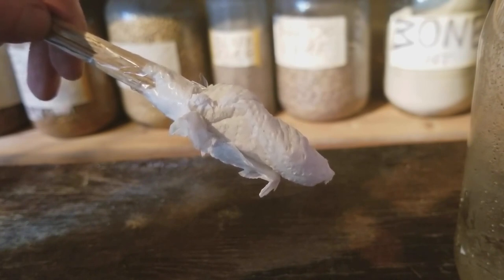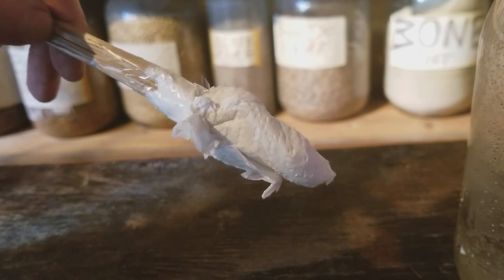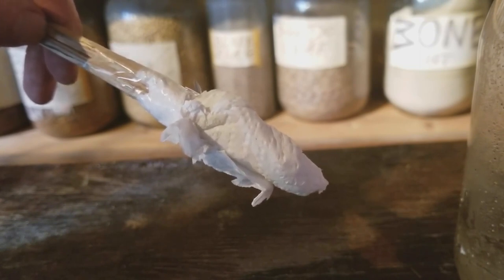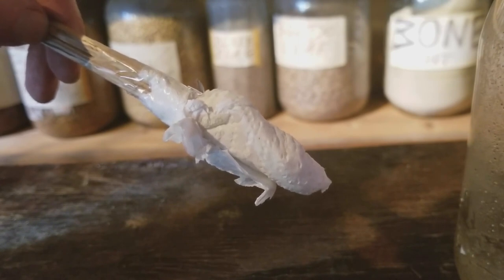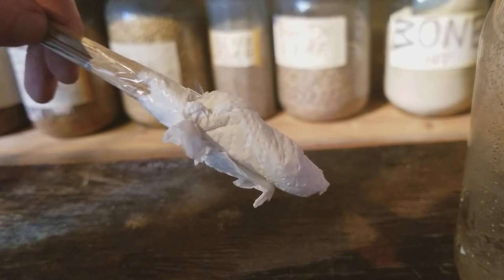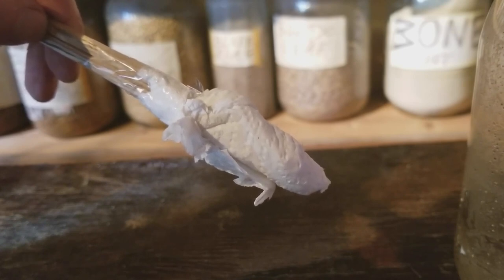And then after that, I'll spray it out, and then I'll put it in the sun with the bottom open where the fuel pump system goes in, and leave the cap off so that the sun heats the tank up and completely evaporates any water out of the tank.